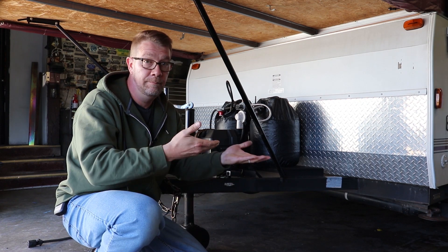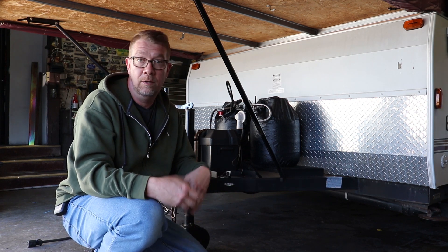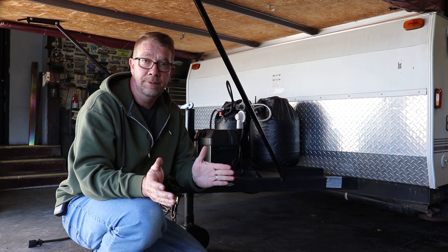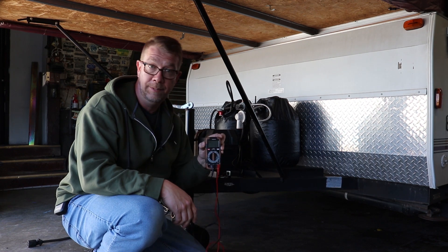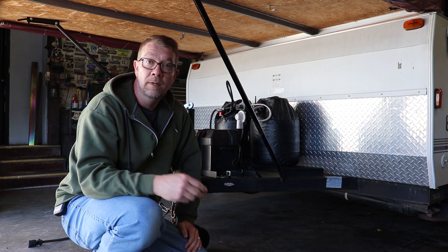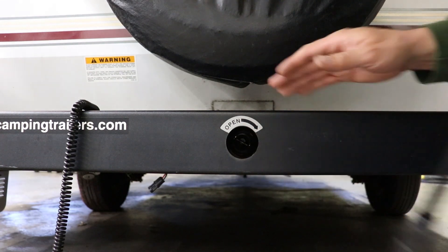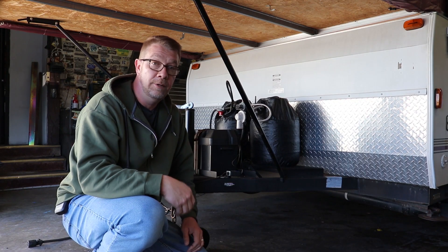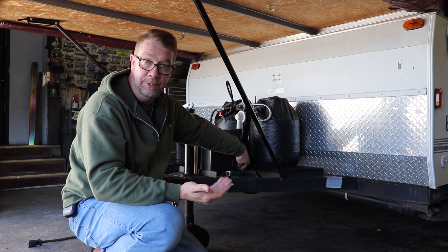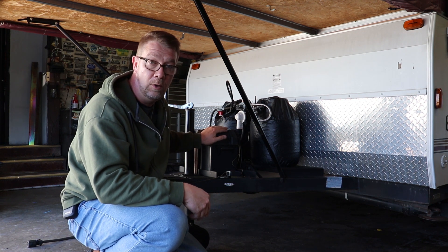Say you get to the campsite with your pop-up camper with the power lift system and the power lift isn't working, or you have a dead battery and you don't have any shore power. Here are some voltages you can check if you're lucky enough to have a multimeter while you're there, or one you could borrow, or when you get home to diagnose a problem. I'll also show you how to override the system and raise the unit with a power lift using just a normal crank handle. First, we're going to take the cover off the battery and check the connections and battery terminals.